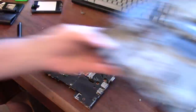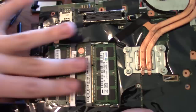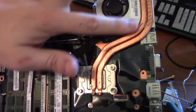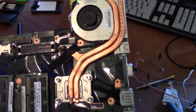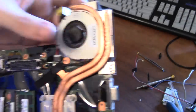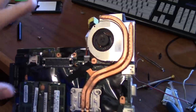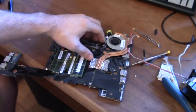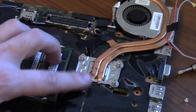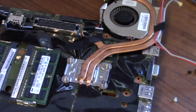Now let's flip the motherboard over. On the back, the CPU is down there. This is RAM — you don't actually need to open up the motherboard to change RAM; you can just unscrew the cover on the back. Your CPU is here. This little copper thing — basically, you have a heat sink that takes the heat from the CPU and transfers it over to the fan where it can be blown out. Since you have this opened, it might have a bunch of dust in it, so it's a good idea to clean it up.